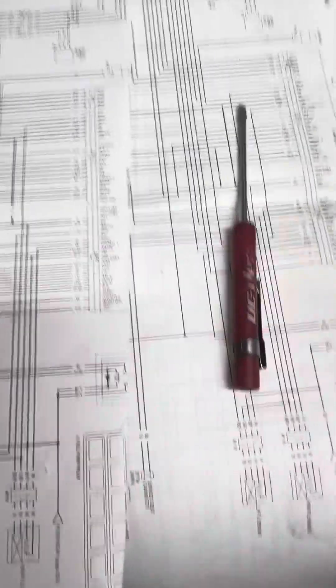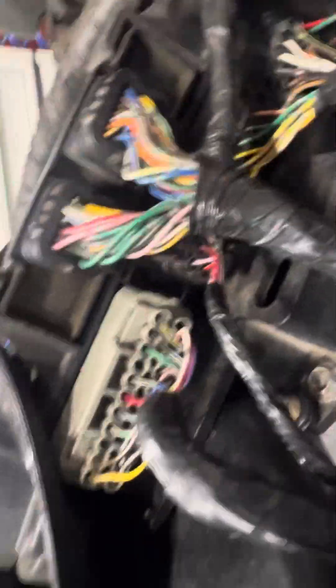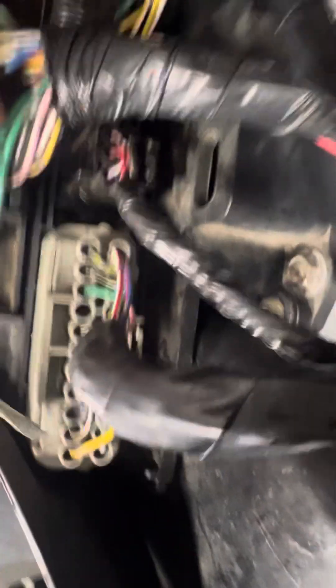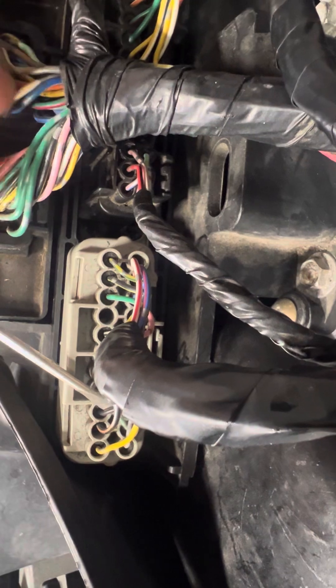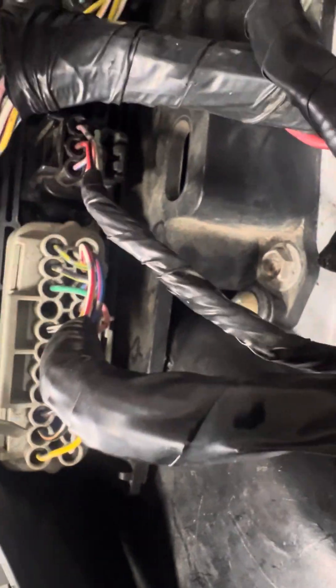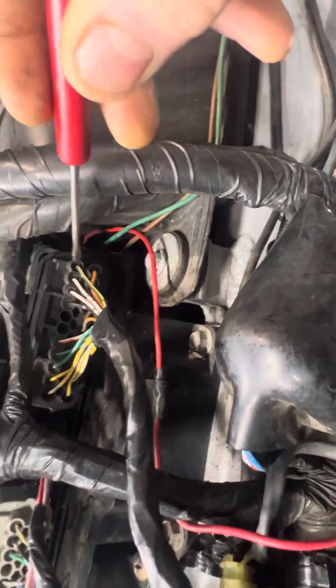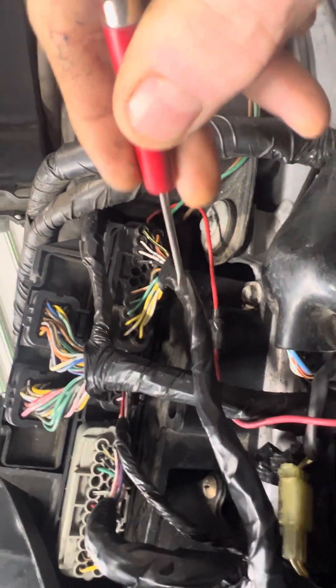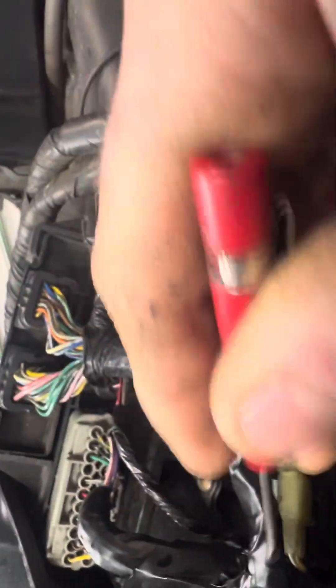I did a continuity back-test on the ECU just to make sure before connecting it up, because I was worried I might damage the ECU. So this wire here on the UK bike — basically between the yellow and the black-and-red — this one is normally empty. What I've had to do is pop a connector in there. I found this black-and-yellow wire coming out of the loom — there's only one on the black connector — which feeds the ignition and other components, and I've connected them together.